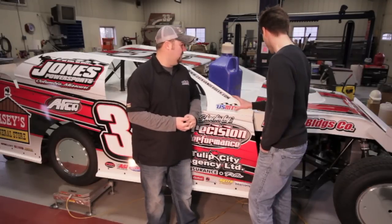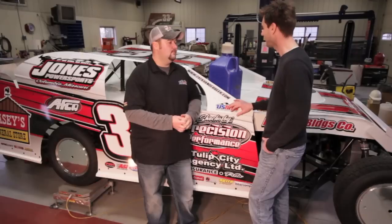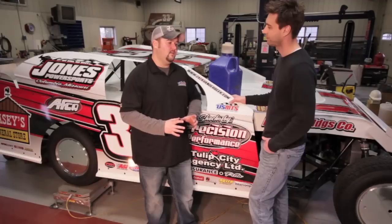Now that we've got the ride heights adjusted and we've moved some weight around in the car — static weight like fuel and lead weights — you've got the percentages where you want because you're more worried about the percentages than the raw numbers themselves. Obviously total weight is still involved, and sometimes you have to sacrifice being a little heavy to get the proper percentage you want. You still want that optimal rear percentage and optimal left side. When your ride heights are set, the other thing I really focus on is the difference between the left rear and right rear — the wedge number or bite number. We shoot for a range there and adjust it depending on track configurations — that's another really key tuning tool to make the car work right.